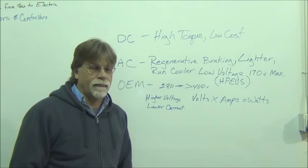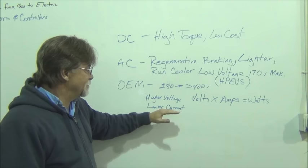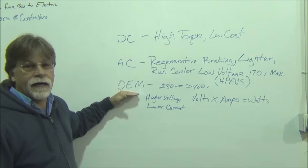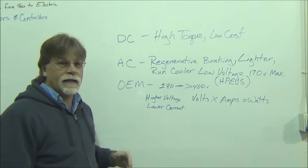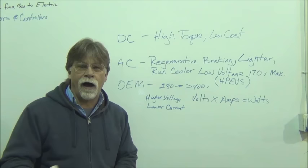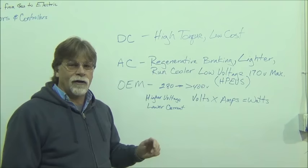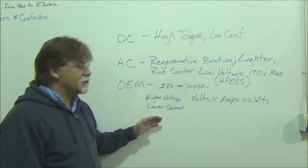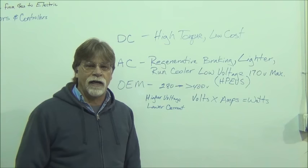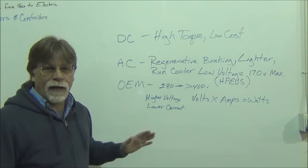Another issue, I guess, with this is that where these were basically plug and play, this isn't quite yet. Now, there are people out there that are designing interfaces that will allow you to communicate with these CAN-controlled OEM motors. But they're kind of a one-off scenario still, and it's not, you know, a buy-it-off-the-shelf item like the motor might be. And so that's one shortcoming at this time, and that's at this time. This all changes pretty rapidly. We've seen a lot of changes since 2008 when we started doing this. So anyway, those are your three basic motor options as of January 2017.